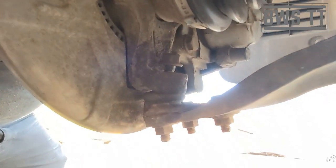One other thing about the reassembly process: when doing up this bottom ball joint nut, the easiest thing is to apply pressure under there with your trolley jack — that pushes the shaft into the hub and holds it in place so you can do the nut up. Everything else is pretty straightforward.